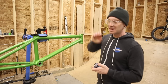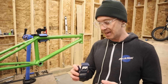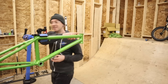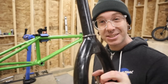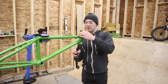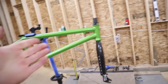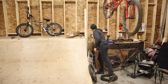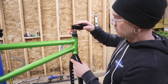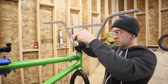For the next bearings, headset bearings — so easy. I'm using a Merritt headset. Pretty much all decent BMXs use an integrated headset, which means no pressing in of cups, no real anything. Just throw a little bit of grease in here. This one actually has the crown race integrated as well, so no tools, super easy. The bottom bearing goes in with a little grease in the lower — grease is a good thing. I used to never put grease on my BMX stuff, which was stupid. Because a lot of frames have converged to that four to four-and-a-half inch head tube length, it's allowed BMX forks to simply manufacture with steer tube lengths that work without needing any cutting. Installing stems and forks this way is super easy because all the guesswork is removed. Whatever handlebar height you're trying to achieve, you can just do it with different rise bars or different rise stems.